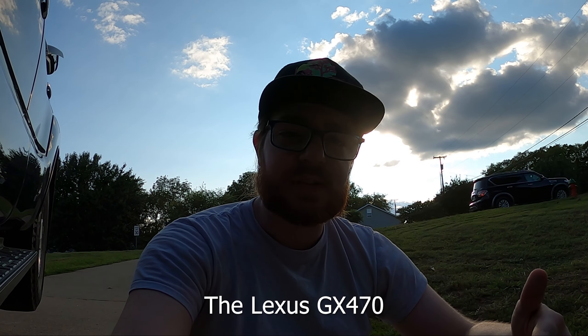If you keep doing this you won't have to replace your driveshaft for a while, but if you do, I've heard that the Lexus version of this vehicle — I think it's the GX something — Toyota actually fixed the clunk issue in that one. So if your driveshaft ever fails, just get a driveshaft from that Lexus SUV — it's the one with the V8 from Toyota. People said that driveshaft goes right in, so there's some advice. Anyways, go ahead and leave a like, subscribe to see more videos like these. You guys take it easy, I'll see you later.